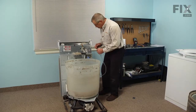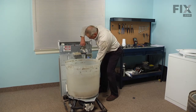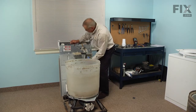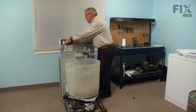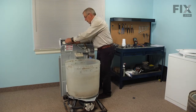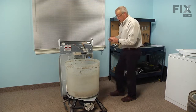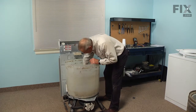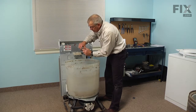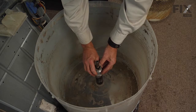Next, reinstall the air dome tube — remember to feed it up through the retainers on the back panel, then make sure it's fully inserted onto the pressure switch and check that there are no kinks. Next we can put the drive block back on the spin tube — simply slide it down over and push it firmly into position, keeping the two tabs on the spin tube lined up with the two openings on the drive block, and making sure those tabs protrude into the opening.